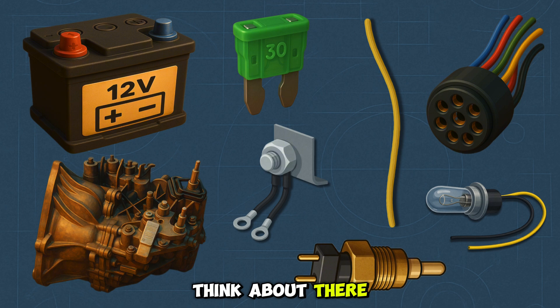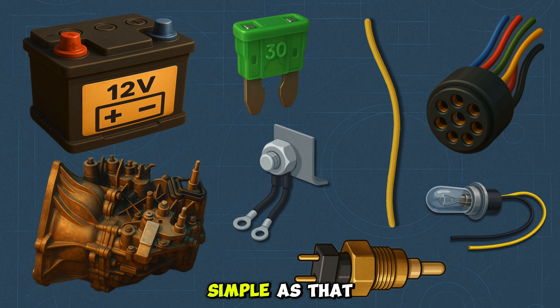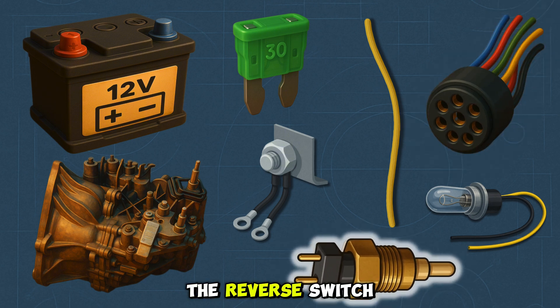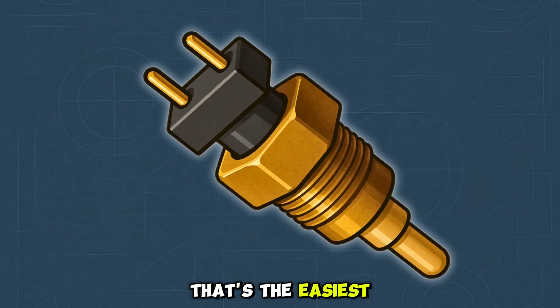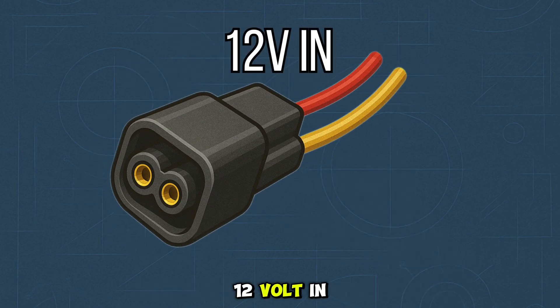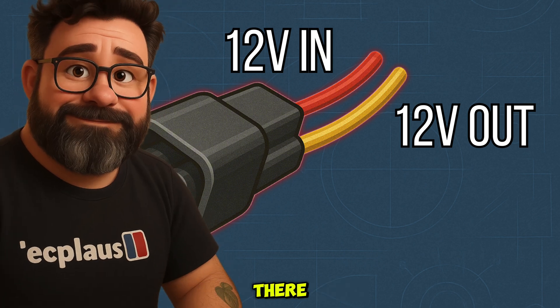There are four things to think about: the wire, which is the yellow wire coming straight from the reverse switch output straight to the back lamp - simple as that. There's an intermediate connector on the left front headlamp area on a Mini - very important. And last but not least, the reverse switch itself, which is a simple on/off switch pushed up by the gearbox when the driver puts the car in reverse. Now we need to test it. Before you start pulling switches out, all you need to do first is take the connector and disconnect it from the switch. You've got your 12 volts in - you can confirm that - just bridge it.